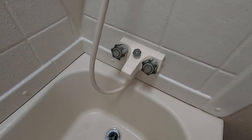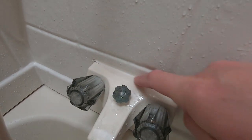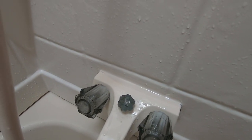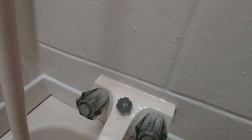You should carry it all the way through here and along behind. I also place it over here where it goes to the exterior door that services our washroom. Another place you want to put it is around the fixture for the taps. They do it from the factory, but I add extra there to protect that area as well, because there would be a hole through this panel to service the pipes, and you want to ensure you've got that sealed off.